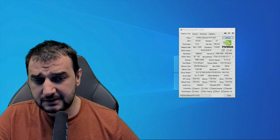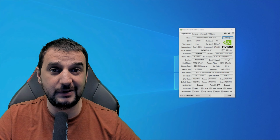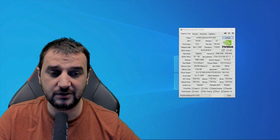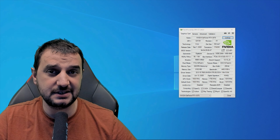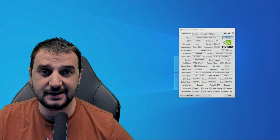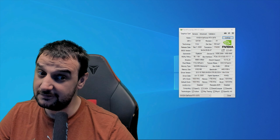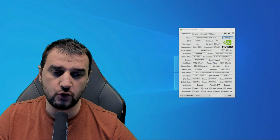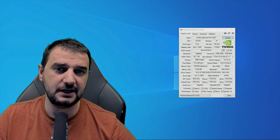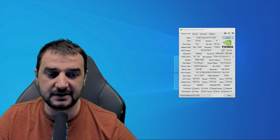It's one of those video cards that, unfortunately, came at that moment in the year when everybody was using them for crypto, and I put it on the side and never used it. You managed to see the thermal paste was stone cold and I got high temperature. But even with that MX4, I managed to learn something very valuable today: every single GPU that passes 200 watts of consumption, you cannot use MX4. You have to use MX6 because that's much better on the thermal side.